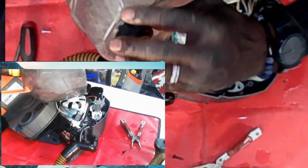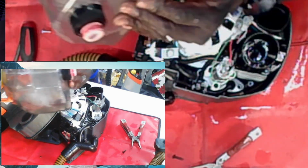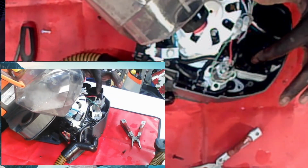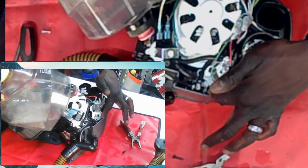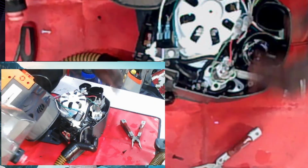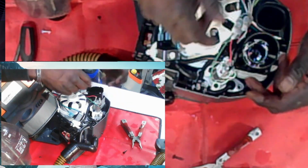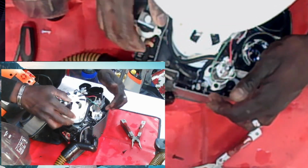Okay? Or if the surface is kind of warped, like it's sunken in. So this is a good way to indicate whether or not your auto receiver and your tank are doing their job. The moment you put it on, you can take this little hose off, and then you see water just spewing out. Now, if water is spewing out, but let's say you're not spraying, it's not strong, or you're not getting water to the floor, then water to the floor has to go through the solenoid and the pump. Okay, the pump has to send that water.